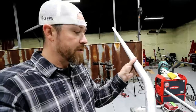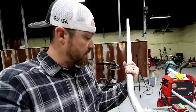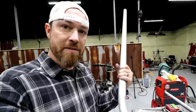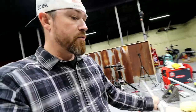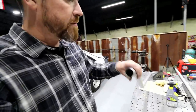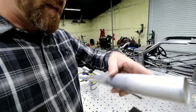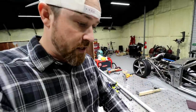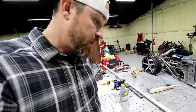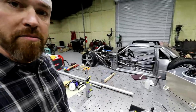For fluid transfer and coolant transfer, I'm okay with that wrinkle on the inside. I just bent this so it hasn't been through a real-world test — no coolant, no heat, no pressure — but based on what I'm looking at, it doesn't look like it's fatigued on the outside. It just wrinkled on the inside to accomplish the bend. Now I just gotta figure out how to fit it in this bad boy.